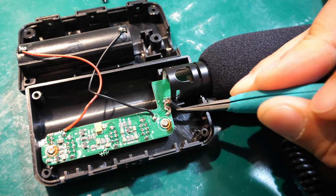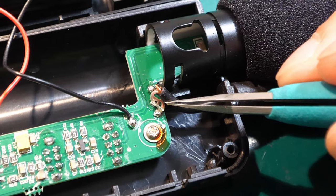Both of these use a single AA battery, which is a little bit cheaper than buying 9-volt batteries. Now the Takstar $25 mic is a mono mic. I opened it up to check it out. They just wired the left and right together. The Audio-Technica is a stereo mic, and you can see roughly about 10 dB of stereo separation if you're on one side versus another.